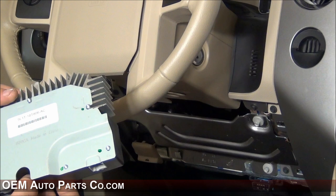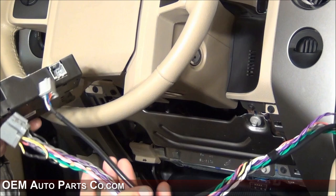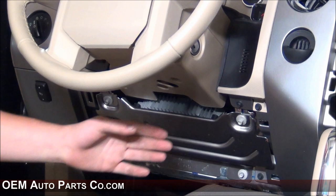In order to do so, you can use metal tapping screws, bolts, or zip ties. You'll then need to plug your amplifier in to the T-harness that we ran to underneath the knee bolster. Once you have this done, you can reassemble the knee bolster. As you can see, I've mounted my amplifier using a few metal tapping screws.